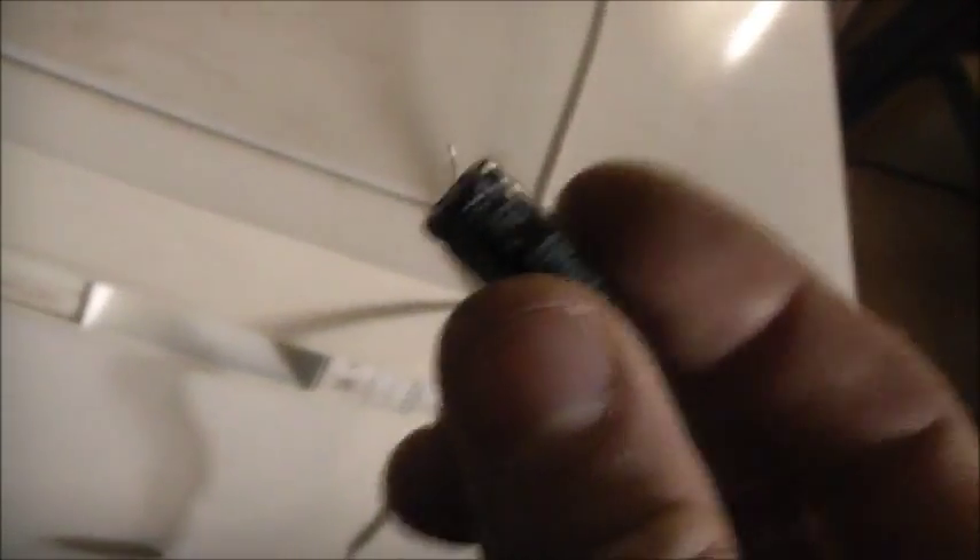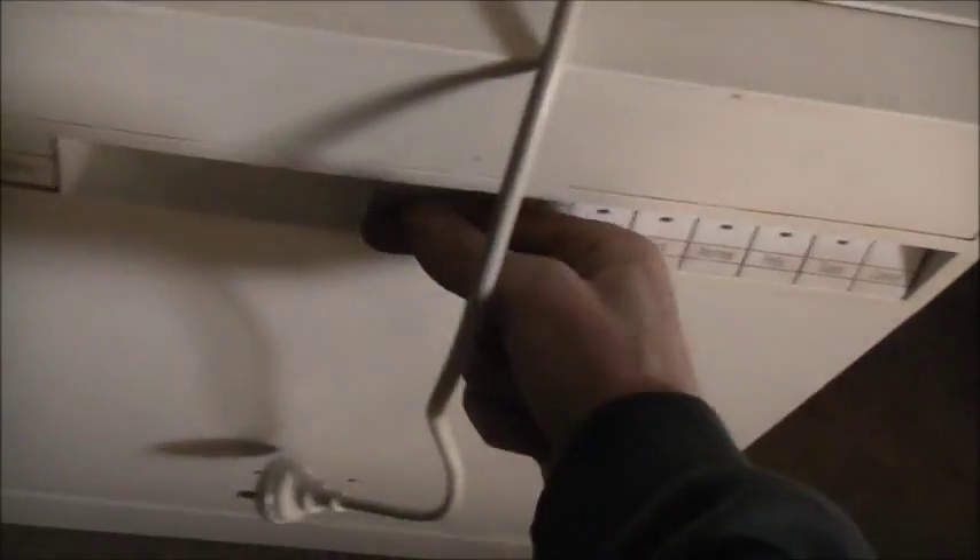Okay viewers, I'm going to take the bottom plate off this and inspect all the pipe work. If no perished rubber or no cracks, all looks intact and in perfectly good shape, I'm going to rack this thing on test and give it a good rinse out because it hasn't seen water in ten years. 1992 — Australian made cord, that's the original cord for this machine. So it's an L-090, a very popular dishwasher. I don't know if the repairman actually took the original membrane out to see if it was actually that switch that was buggered in the first place, because this could have failed and taken the whole circuit out. The ripple would have upset the chip on that board and it would have gone through a safety shutdown, turning everything off, even the beep at the door.